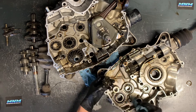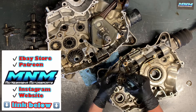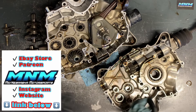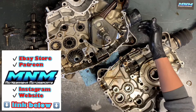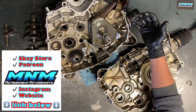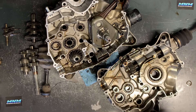I'm going to remove this idler gear, keeping in mind we've got a washer down below there. Both sides of this gear look identical so I don't think it matters which direction goes in first. We've got our crankshaft. We'll set this motor up and just tap the other side of the crankshaft out, and that'll push that crank out, then our prop shaft will get removed as well.